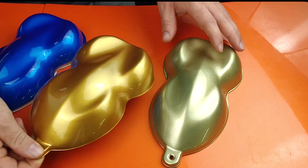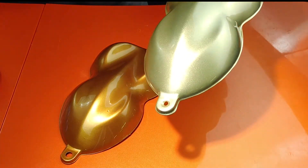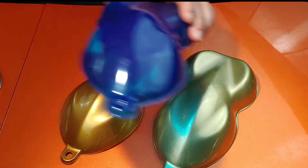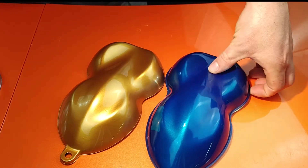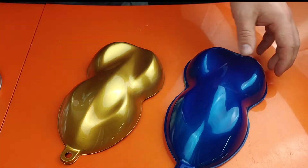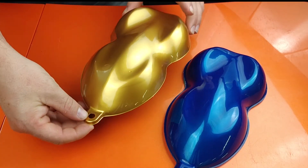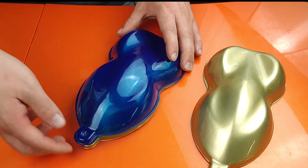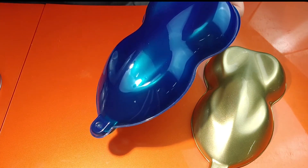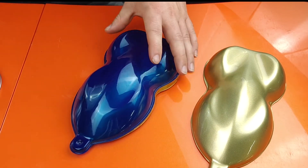You might want to go with a gold base coat. That's popular. The G212 Sunset Light Gold is a nice coarse metallic — you get a nice reflection and good depth out of that. Or if you want something a little more subtle, you can go with the Egyptian Gold. This is a popular base coat for the candies; people just like the way it looks. This one's going to give you a little more of a green effect and it's going to darken it up just a little bit.